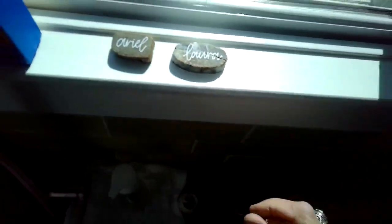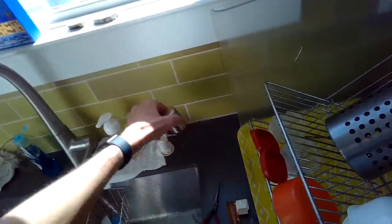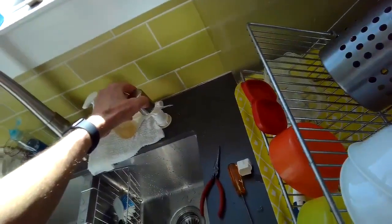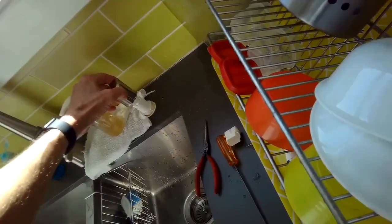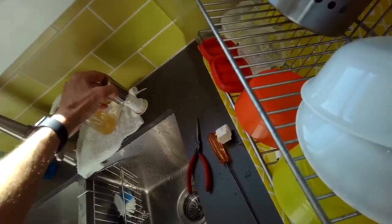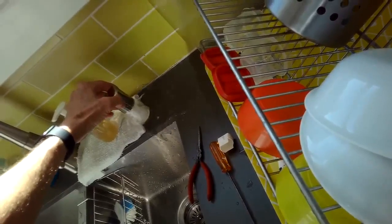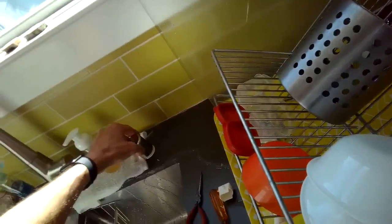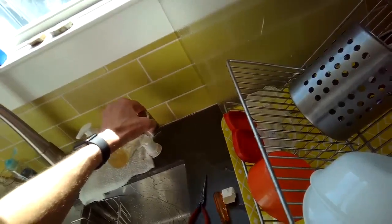But you often find seeds get caught in there, and it's just a common point where things get snagged, or a little fishbone. So I'm letting the water shoot now right up into this silver cap. I'm just testing how much water comes out when I close the door and the drain activates. And when I did that, I got a big column of water shot out. So the drain is doing really good. Whatever was in there is no longer blocking it. I think it was that little piece of plastic.